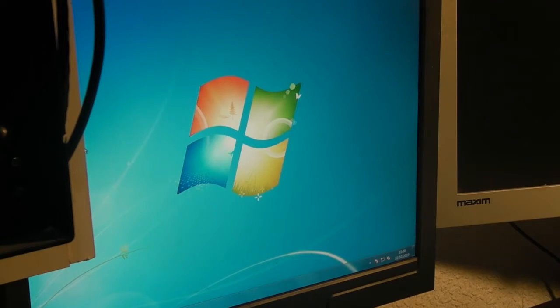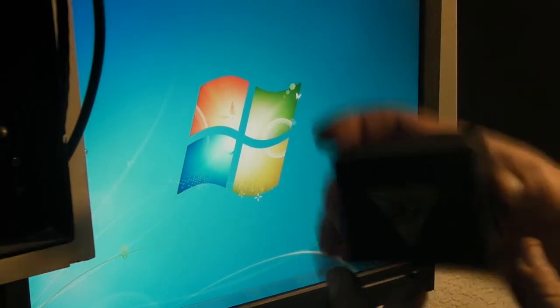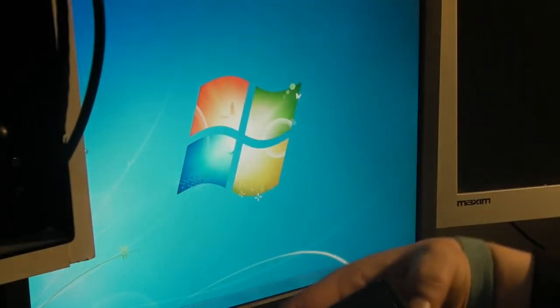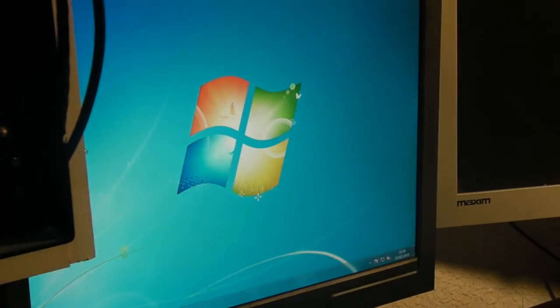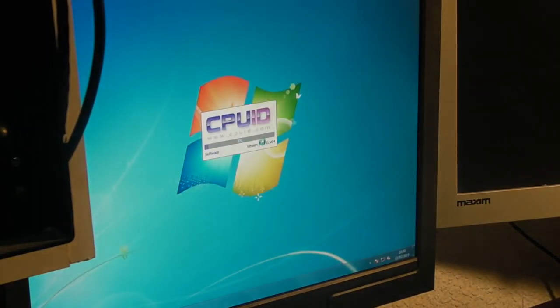So I'll show you a bit about that, and then we'll have a go at flashing that BIOS to this computer, and then we will actually crack the computer open and we will install the modded CPU, and we'll install that 8 gig of DDR2 RAM. 8 gig is the absolute maximum that that motherboard will take, so we're basically taking that computer up to the maximum you really can. So let's just run CPU-Z now,